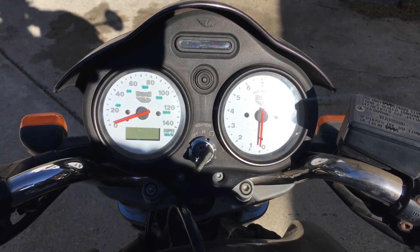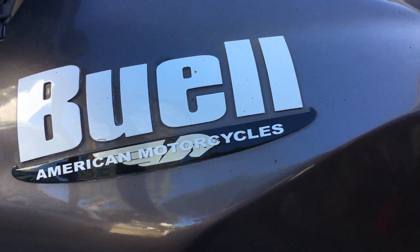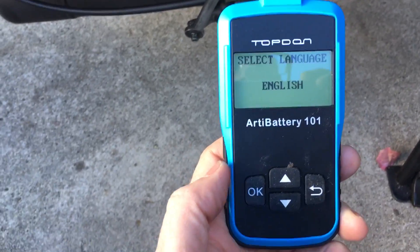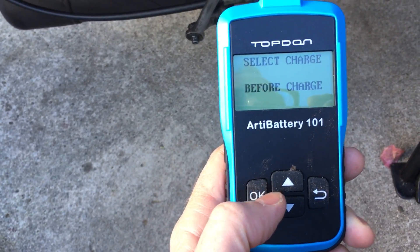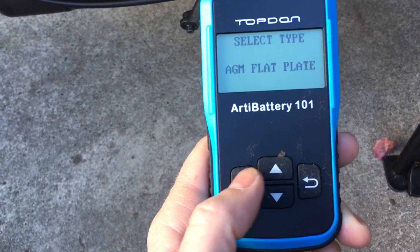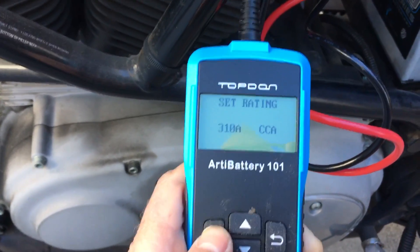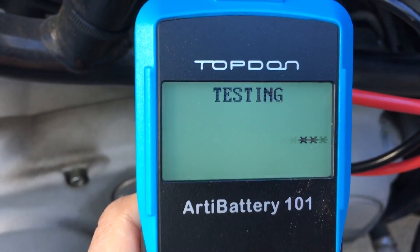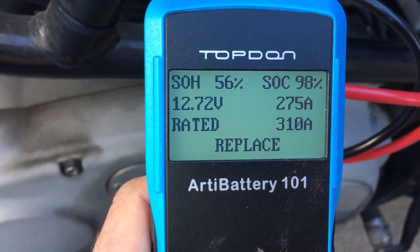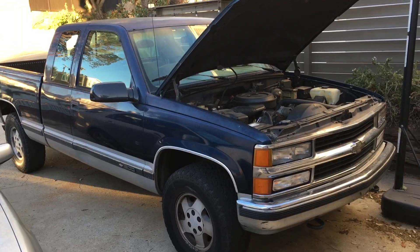Now on to my motorcycle — not just any motorcycle, but my motorcycle that won't start. My American motorcycle. We plug it in here. This is an AGM battery — absorbed glass mat, I believe that stands for. A different type of battery; they told me it was better and charged me more money for it, but it still doesn't work. AGM flat plate — let's see how it tests. 310 cold cranking amps. You want to adjust the amps for whatever battery you're testing. Replace. It's 56% health, even though it's all the way charged up, and it doesn't want to crank the old big 1200cc bastard over.